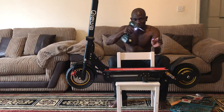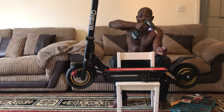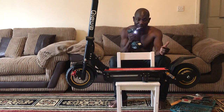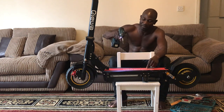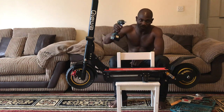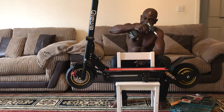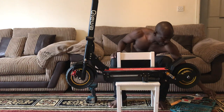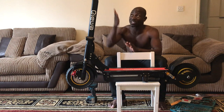Once it started a little bit, you move to the next one. When you've done it for all of them, and you show that every one of them gets almost the same amount of torque, then you go hard on them. Then you go on again, don't go hard, just from this one to that one. You're going to go hard on this one, again, diagonally. You do it all round. And once you've done that, you should be back in business, because you already tested the scooter.